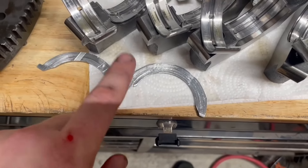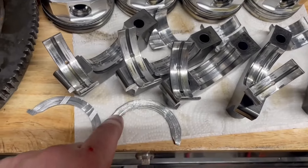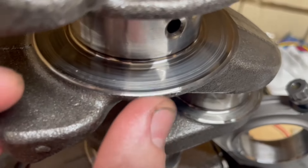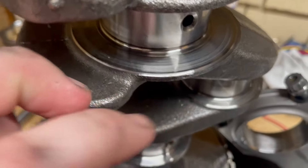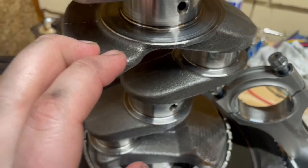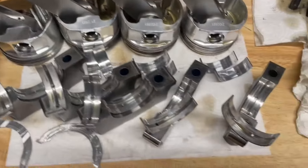We're going to talk to the machine shop about that because this is all getting sent to a machine shop to get inspected — always good to get a second opinion. The crank itself looks fine. This is where the thrust washer was rubbing and there's nothing horrible — just a bit of an edge where some material was rubbing. We'll see if they want to replace the crank, especially with the nose issue on top of this. We can special order these a little bit thicker or thinner if needed. Otherwise everything looks great.